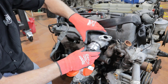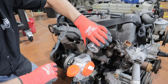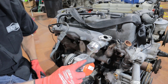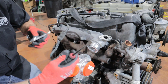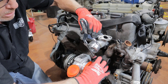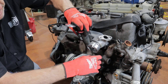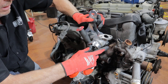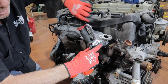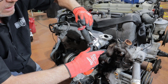With that, go ahead and push it in — it will be a tight fit. You can use a pry bar, a screwdriver, another wrench, whatever you need. Then we have the Benzforce wrench, and the goal is just to keep the center section from spinning. I'm also pushing into the engine as I tighten it because I don't want it to work its way back out.